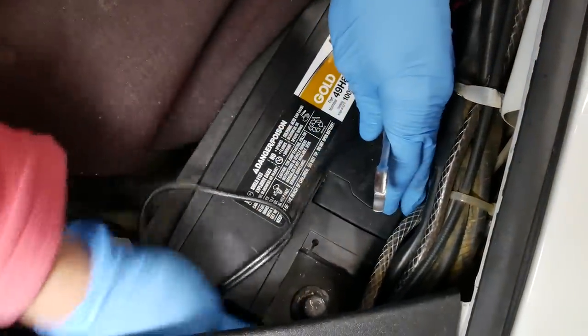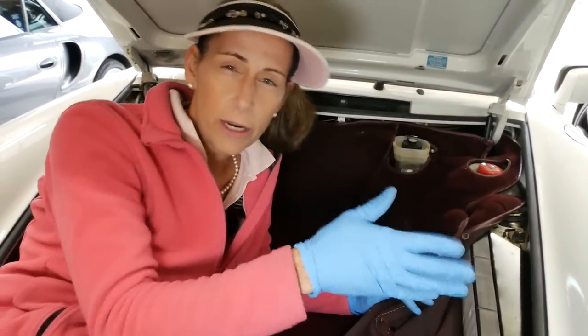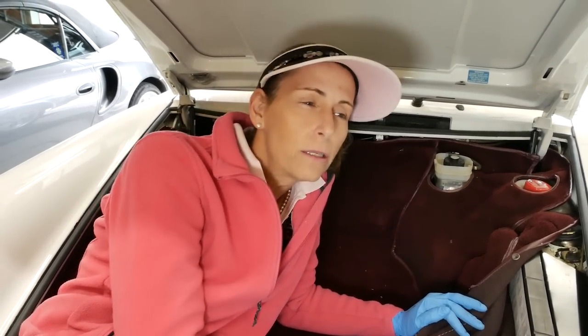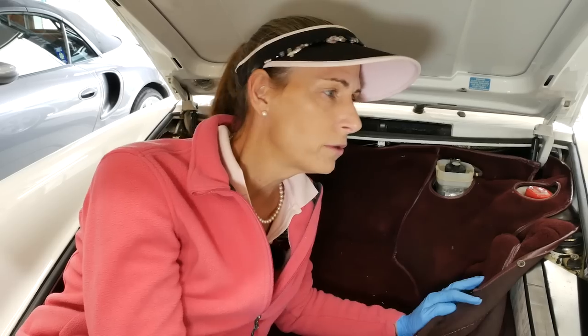Take that off and put it aside. Another thing that I think is really smart to do — I read it in the book — is to go ahead and pull the fuse for the fuel pump. The reason is there'll be times when you're dinking around with the car and maybe you'll run a window up and down and turn the ignition on. If you've got the fuel system apart, which we'll have to do to pull this engine, that fuel pump is going to crank up and fuel is going to go everywhere. That would be really bad.